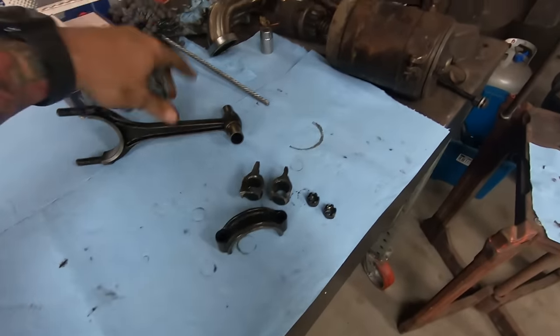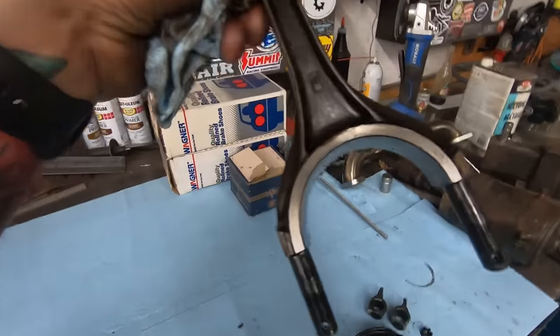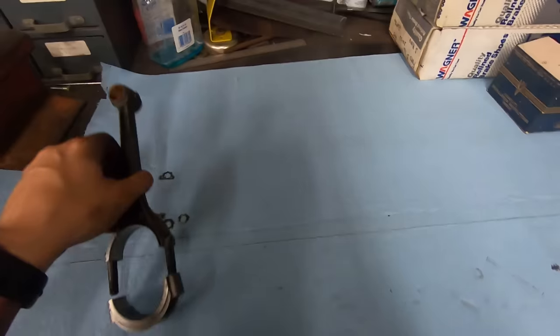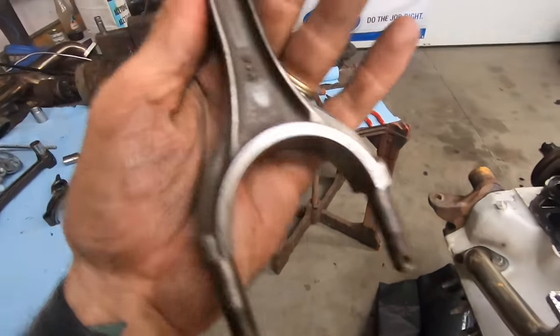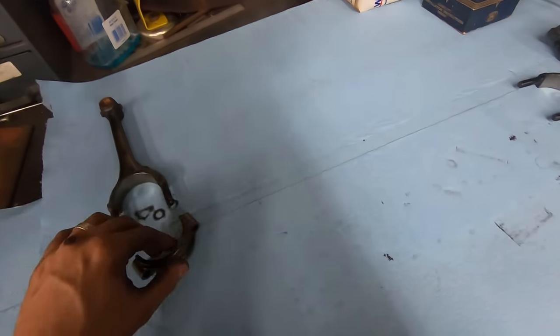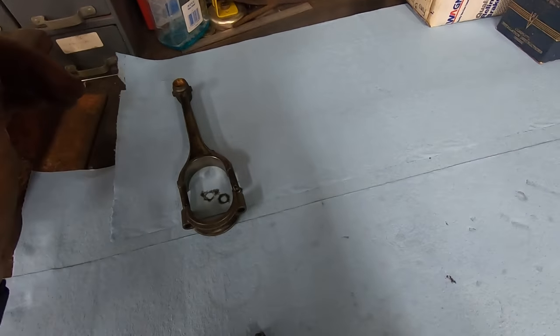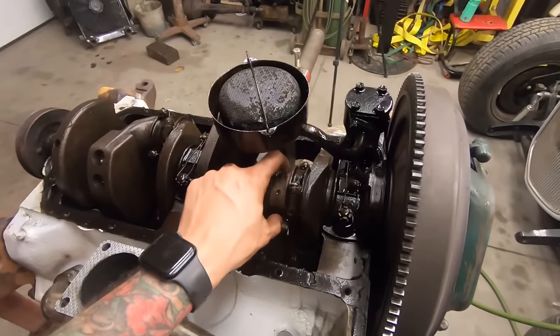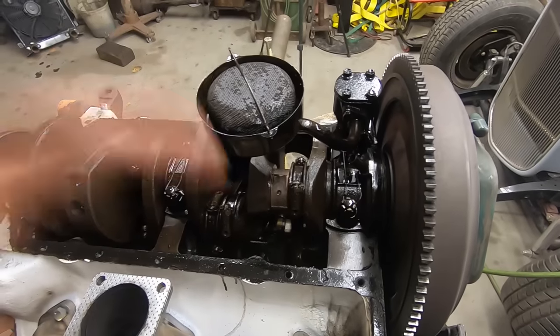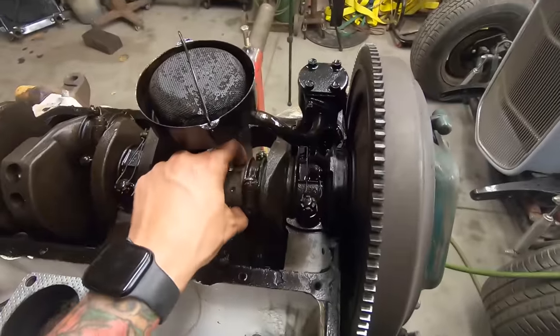Yeah, so this rod was messed up, you know, 91A, that's what it is, 91A rod. Luckily, I hoard stuff. Look at that, 91A. So I have another one, and the bushings have been replaced. So, before I just send this and have it freeze up, I'm going to torque it down. I'll make sure I have some movement in here because stuff expands and stuff. So some movement is okay.